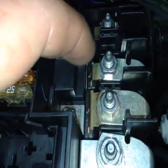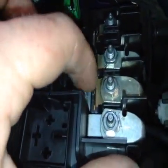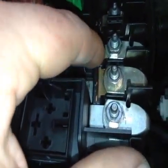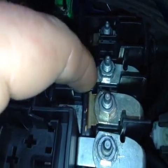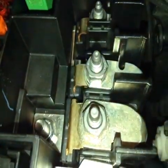the fuses here are along this plate. The battery supplies power into this fuse panel, and then each one of these terminals next to it has its own fuse or fusible link built in. So the fuse appears to be open, because they all test at 0, which a good fuse would, 0 ohms of resistance, and this one tests outside of the limits of the meter, which essentially means that it is an open fuse, otherwise a blown fuse.